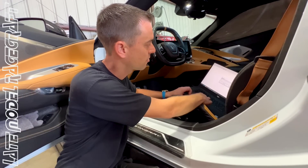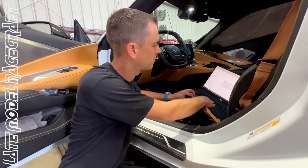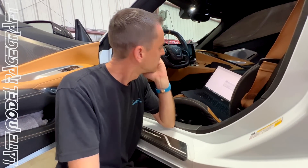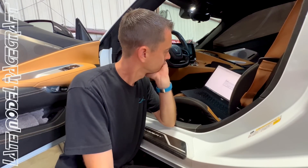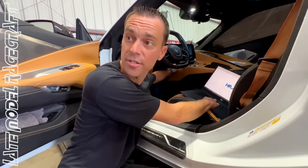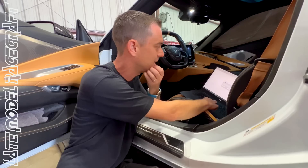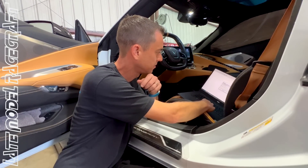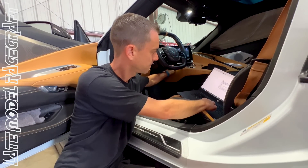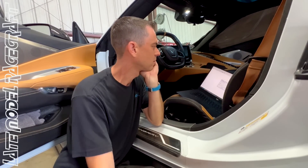Read. Gather the vehicle info first and see if that works. New steps — we're learning. Ignition back on. Let's detect the ECM. We click read, then turn the ignition off, and now we press continue. Come on baby — and there we go, she's reading. So yeah, it's wild — everything with the ignition.